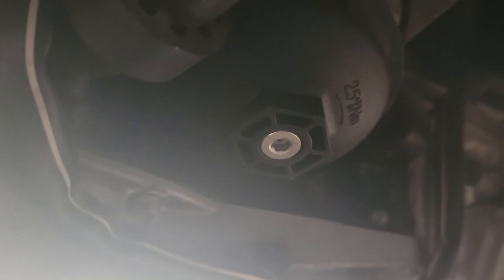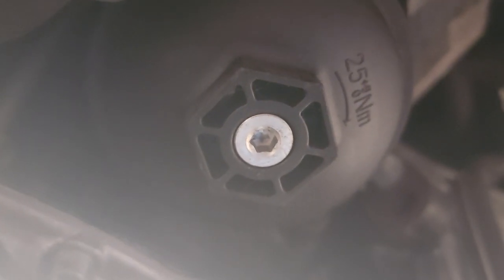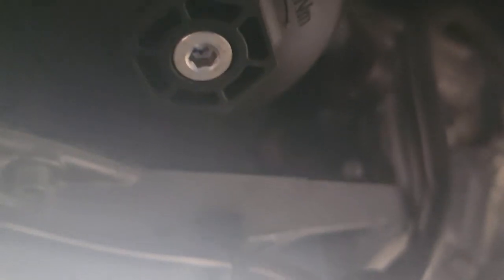I've got the oil pan drained and the plug put back in. Now we can address the oil filter. You'll need two things: there's a center piece that takes a number six Allen key — a better design than on the 2006 Jetta. You unscrew that and it becomes the drain for the oil filter. Once that's drained, you'll need a 36 millimeter socket on a half-inch drive. That goes up onto the filter housing and you turn it counterclockwise to remove the housing, then replace the filter.